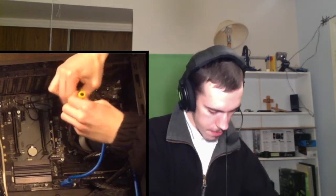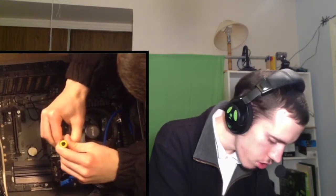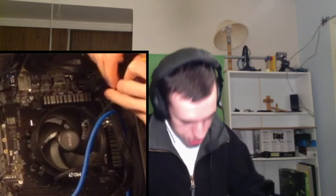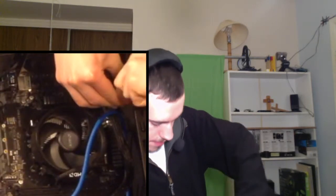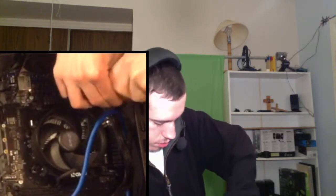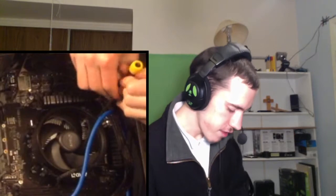Once it's produced a lot of heat and the paste has been affected, then you start running into more issues — the thermal paste might not be applied quite right if you just take the cooler straight off, rotate it, and put it back. You might need to reapply the paste, but since this one hasn't really done anything yet — it just waited for 10 seconds and then restarted — the thermal paste should be okay. By the way, this cooler is attached to a metal plate underneath, and the metal plate likes to fall down since it's attached only by the screws.